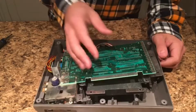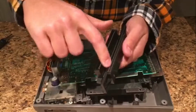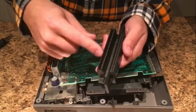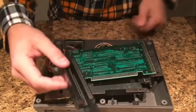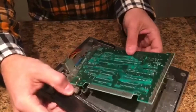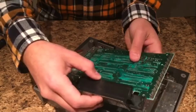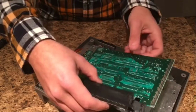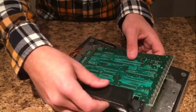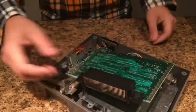the connectors on your board are all cleaned off, and you have your new pin connector. And like I said, you want to put it in this slot right here. Not this, well, it won't go on this one. This is the one where the game goes in that you'd read it. So you're going to take your pin connector, line it up, and try to space it so it's even on both ends so that the pins line up with these metal connectors on the board. And then all you quite literally do is just shove it back on like that.